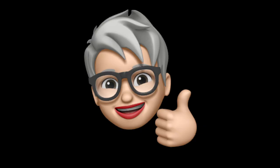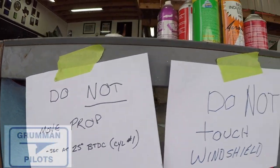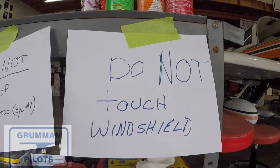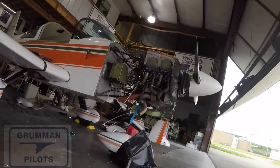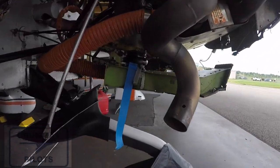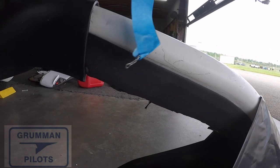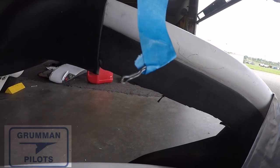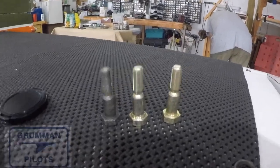This is not an exhaustive list of tips, but we use signs a lot — like when we're rebonding a bow on a windshield, we don't want anybody touching it, and we don't want the prop moved if we've got it at top dead center. Here we're using blue painters tape, and you'll notice there's a cotter pin that has to go back in the aircraft before it's finished, so we don't forget to put it back in.